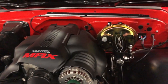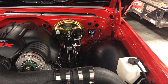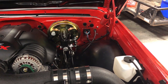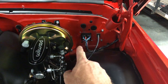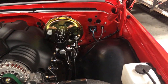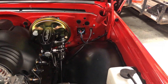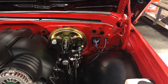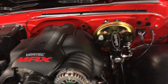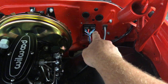As far as the wiring harness goes, great kit — cannot recommend it enough, it is amazing. It has all the circuits you need plus about 12 extras. Goes back in like stock. You do have to trim the bulkhead hole out slightly; I used a die grinder, no big deal. As far as the wiring goes, I wired it like stock. I didn't tuck it because it's got power and engine circuits on one side and lights on the other.